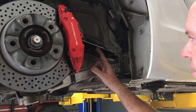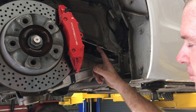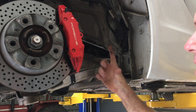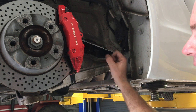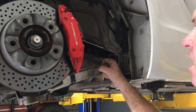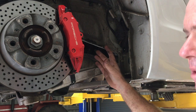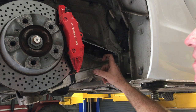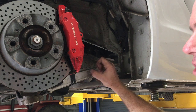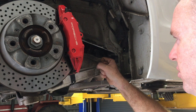When installing the plugs, if they're new plugs the torque is 32 newton metres. You'll notice it feels like it's taking a long time to torque up because of the compression washer on the plug itself. If you're putting in old plugs — for example, after a compression test — they take 25 newton metres, and you'll feel it torques up very rapidly, as you would expect with a normal screw.